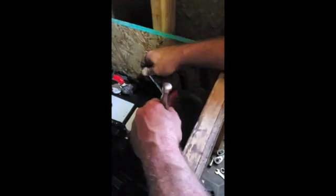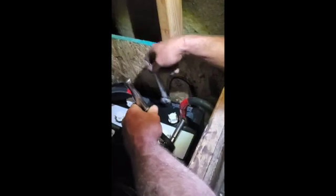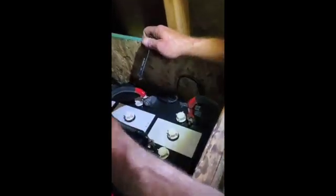So now that we have the wires marked out with positive and negative, negative, positive, positive, negative, they're all in series. And we're getting ready to tighten up each terminal. So what I've done is run the nuts on the right-hand side because I'm right-handed. It makes it easier to tighten.